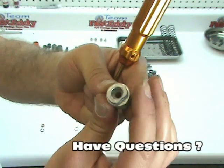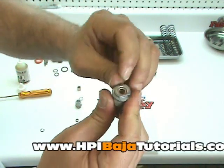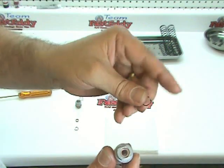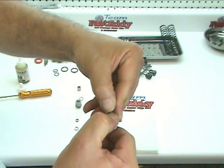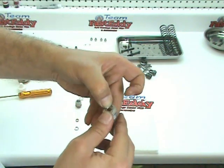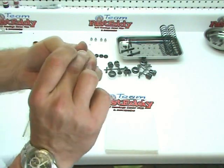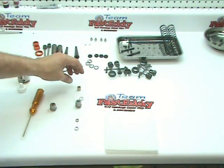From there, take the smaller brass bushing and insert it down inside — it should make contact with the silicone gaskets. There's a little ridge to the inside, and we're going to take the smaller of the two clips and work that in. Sometimes they go right in, sometimes they need a little help. On this one I'm going to use the blunt end of my nut driver and push that down in, making sure it's properly seated all the way around.